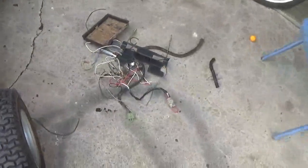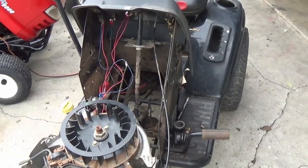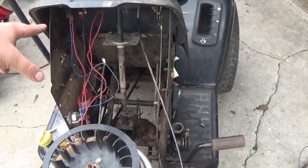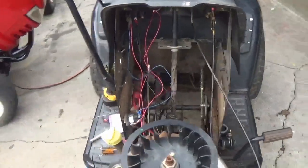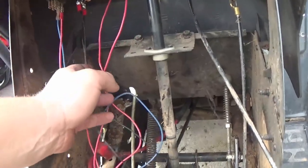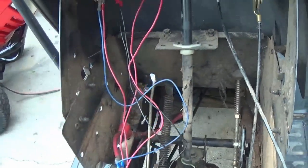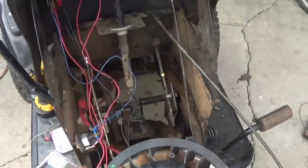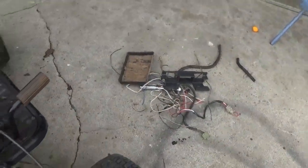There's a bunch of wires right there. I just gut everything out — I like to start from scratch. What I like to do is not have to get brand new wires; you want to try to cut the wires or disconnect them from every spot you can and get the most amount of wire. I like to keep them color-coded too — you've got your red for your hots, your black for your ground. Of course I've got a blue one on there, that's actually a hot but it works. You'll want to strip out all the wires to everything as much as you can; cut them if you have to, just make sure you get enough length.